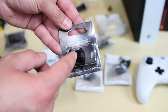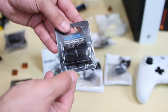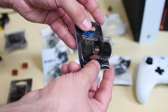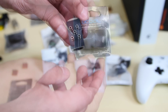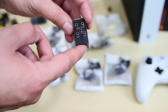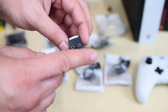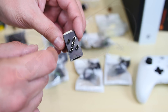I'm also going to be using a lot of these bulkhead fittings from Alpha Cool — they're black. The way bulkhead fittings work: you drill a hole through a hard surface that you want tubing run through, then these two pieces twist together — one goes on one end, the other goes the other end — and both sides have G quarter inch threading so you twist a fitting on both ends and it looks neat. I'll also be using a lot of these dividers — they take quarter inch and turn it to small tubing, allowing us to cool down those little chips like the RAM.